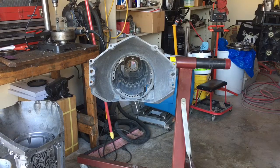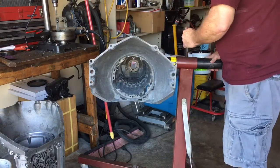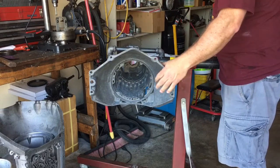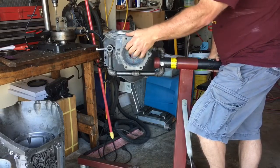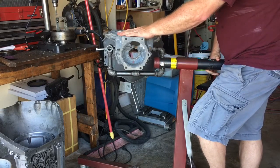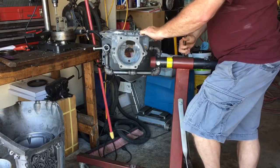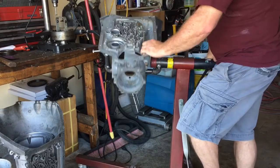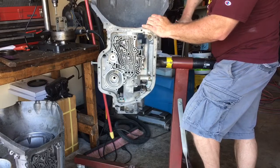There's a good shot of the insides of the 1969 Chevy Turbo 400 case — I've been cleaning on it a lot because it was super dirty. The fixture allows you to work on the case in a vertical position like this. If it's not as flat as you want it, you adjust this bolt on the backbone to get it as flat as you need it for your valve body work.